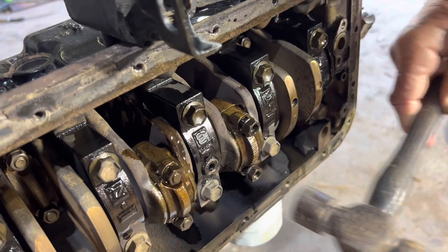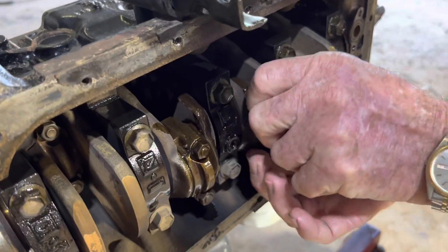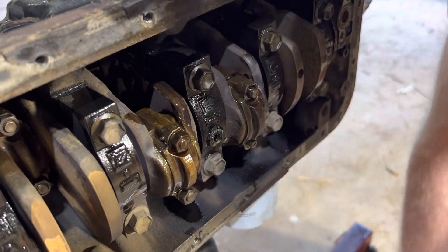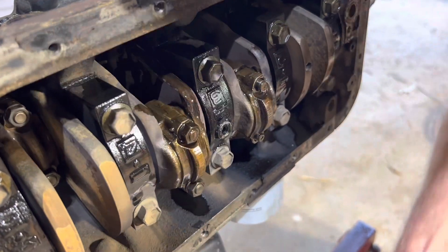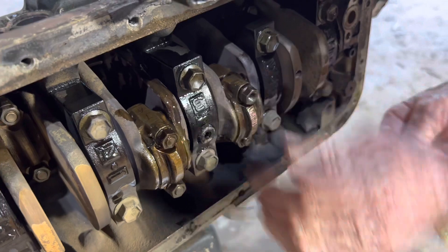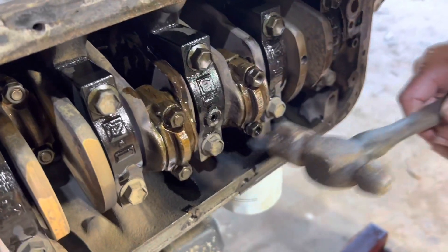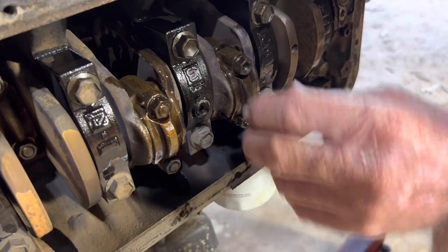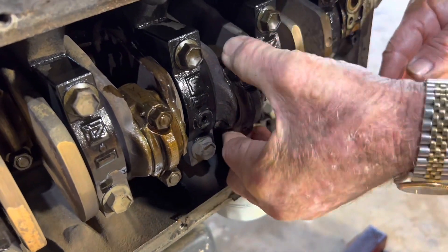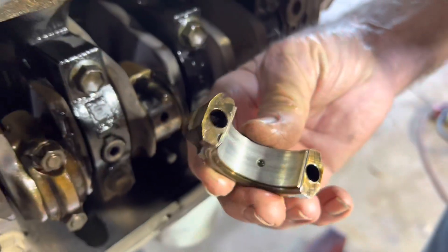Here we are, just about ready to undo the big end cap — just drop that off. We've got our number on here which is facing the right hand side of the engine. Might have to put that back on again, looks like it's going to be a bit tight. Just tap that a little bit more, put the other one on, just let go but not fully — put it on about half a turn or a bit more. Remember the numbers on here are facing to the right hand side of the motor. That's a good sign too that the bearing is still laying in the cap.